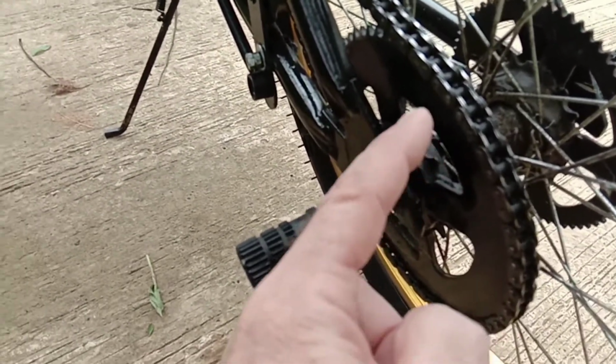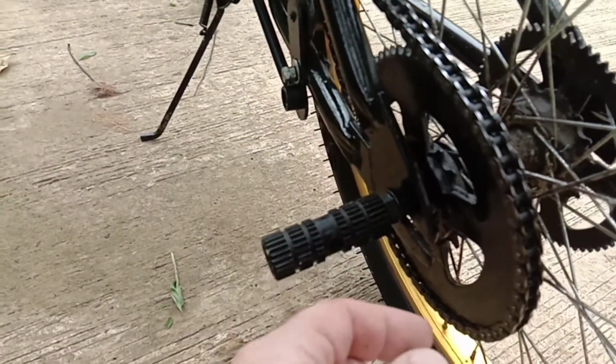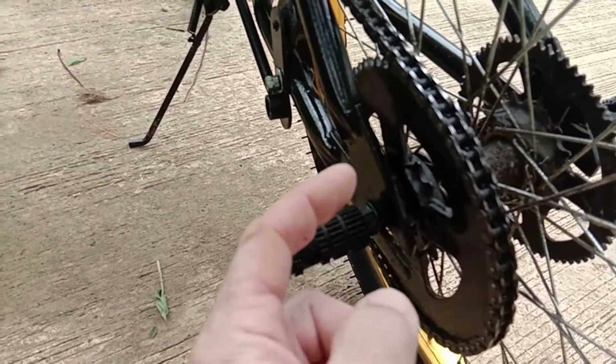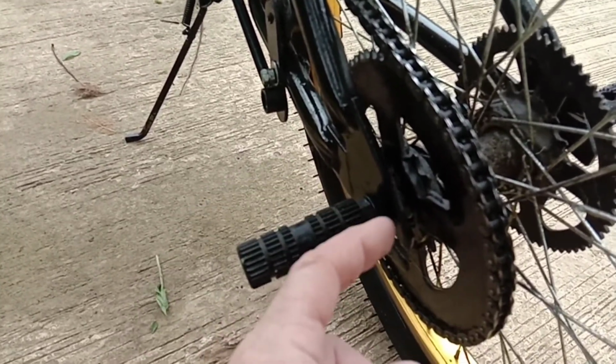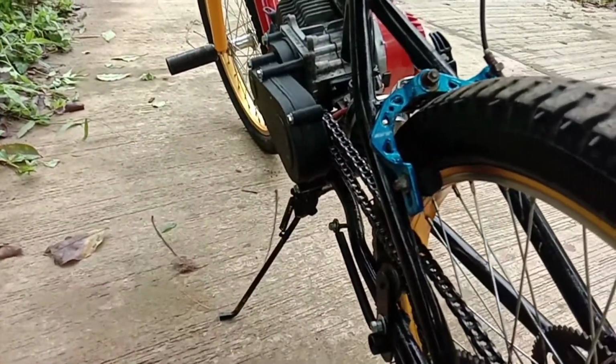And at first I left it be a free rolling click, click, click sprocket, but ride number 2 going up a hill, the power and the vibration of the motor blew all the little parts apart inside. So I had to get a new one and then weld it up solid so that it just coasts, spinning the clutch when I'm going down a hill.